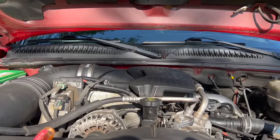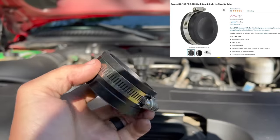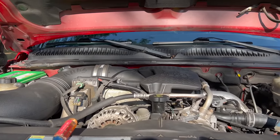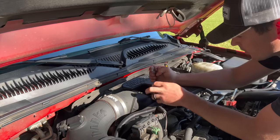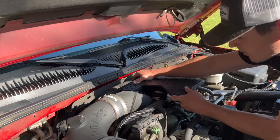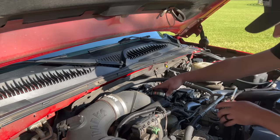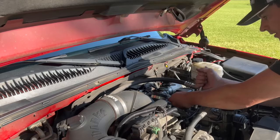Our last mod for today's video is actually our cheapest — we're going to be doing a resonator delete. I ran down to the parts store and got this two-inch plumb-quick rubber cap; it comes with a hose clamp and everything for five dollars and 99 cents plus tax. Get rid of that big resonator — supposedly gives us some more whistle; some people say throttle response is improved. I doubt that, but it should look better and hopefully give us a little more whistle. You need a T30. I'm going to get it with a flat head since mine won't fit in there, and we should just lift this whole assembly off. There she is — lift the clamp up, there she goes. Nice and snug so we don't want any dirt bypassing.